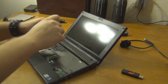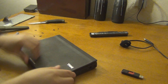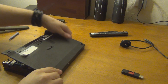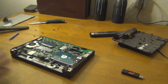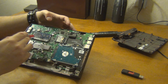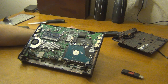I really like the higher-end machines a lot better because there's pretty much one screw you undo and you get access to the memory and hard disk. Much more pleasant. But at this point we should be in. Trying to be gentle here — plastic clips and all. It's not exactly the strongest thing in the world, but we succeeded. Here's our nasty mechanical drive that we're going to get rid of. It looks like this could be equipped with wireless cellular, and it is not upgradable past the two gigabytes — it only has the one SODIMM slot. There's our Wi-Fi, CPU, CPU cooler. It's not really dusty in here, so I don't need to worry about blowing anything out.